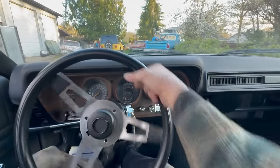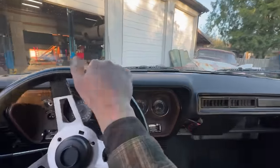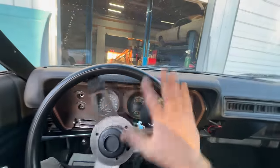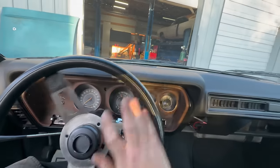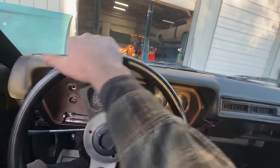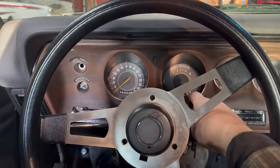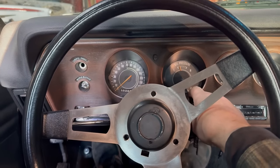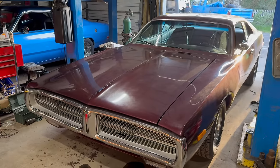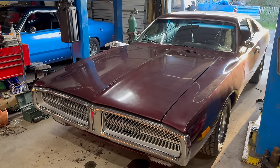I think it was those goofy mixture screw settings. I set them back to your standard 1.5 turns and it's fine. I've always done that by ear, but with a cam like this, it's a little hard to tell what you're hearing sometimes. It steers, it sometimes brakes, and it sure goes. But does it diesel when I shut it off? No. Now it kind of smells rich at idle, like that was too much. But it didn't help the stalling at all.